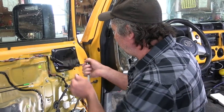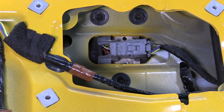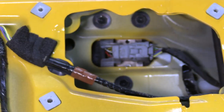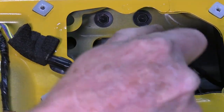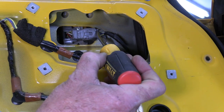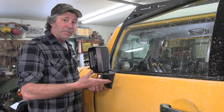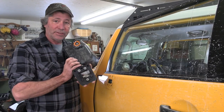This black panel here has to come off — that's 10 millimeter. Then we have to take the mirror off, and to do that you go through where that black panel was. There are two bolts at the top and one bolt at the bottom, and those are all 10 millimeter. Take those out. We need to unplug the mirror — push in this little tab here and that plug comes right out. Now we can take the mirror off.